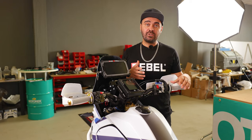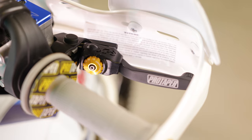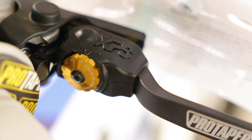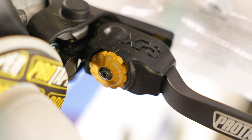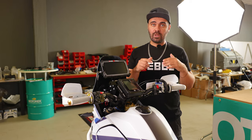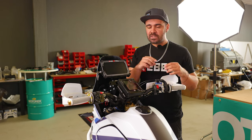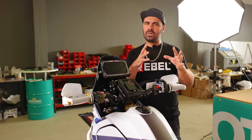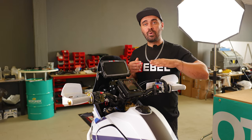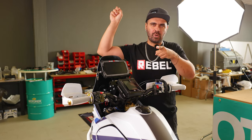The two levers are completely different. We went for a Pro Taper full clutch with bracket system — it has a quick adjuster in gold so you can quickly adjust the clutch. On the other side we have the anti-brake lever also by Pro Taper, adjustable quickly with no tools in seven different positions so you can put the front brake lever in your preferred position for the best feeling and sensibility on the front brake. The front brake pump is different — we went for the YZ brake pump and added a CNC machined cap anodized in blue with the YZ logo. It's an experiment: we didn't want the front brake hose going in the middle.